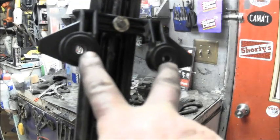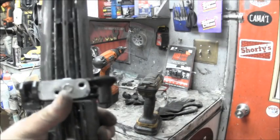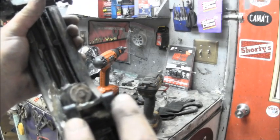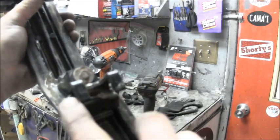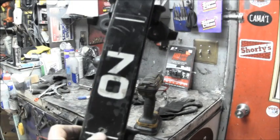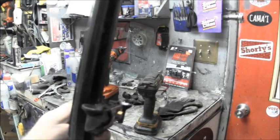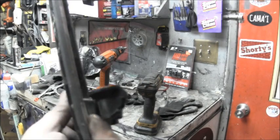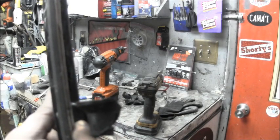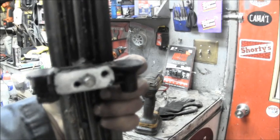And this, of course, bolts to the power head right here. And I don't know if I'm going to worry about having something to bolt to the power head down here, because I got these two clamps, and I think gravity's going to do a pretty good job there. So you can see the end of the bolt right there, and like I said, that's all self-tapping stuff. And right in this piece here, where the bolt goes through, there's an aluminum insert, so I tapped the aluminum. So that should be pretty strong.